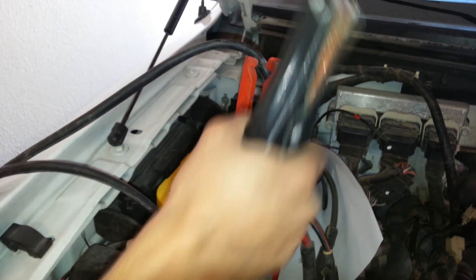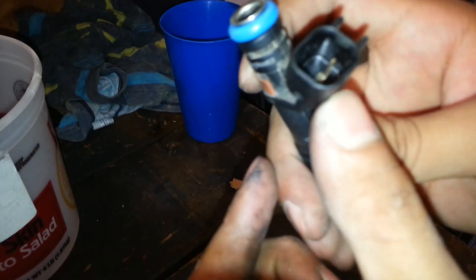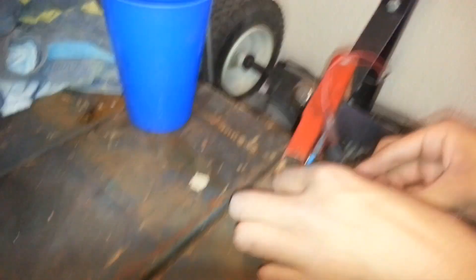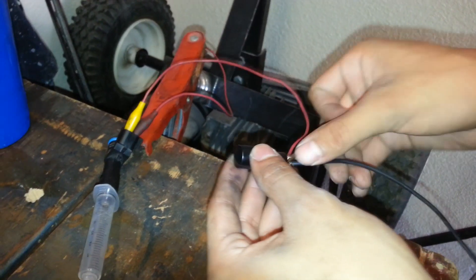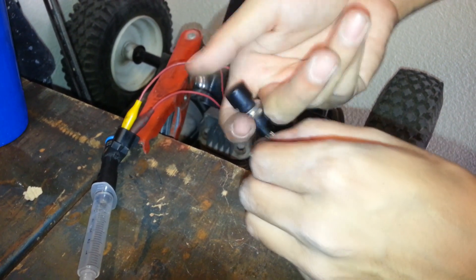We've got these jumper cables — they're going to hook up to the battery and run this way, so that we don't have to hook it up straight to the truck. What you're going to want to do is get two alligator clips and connect them to these. In this case it doesn't matter what side you put them on — just put one on each, and make sure they don't touch. We also have a momentary switch — this is just to open and close the injector so you have control over it. You need to have this momentary switch because if you just hook it up straight you risk blowing the injector. I'll put up a circuitry diagram later — look right in the description.